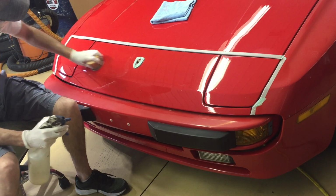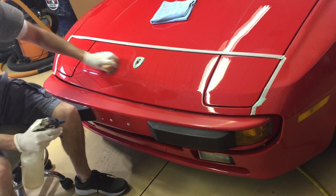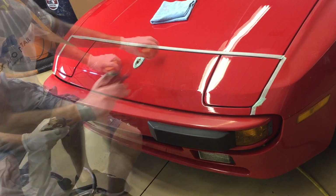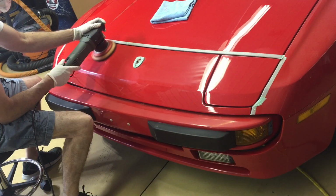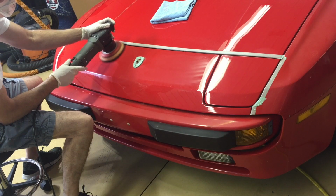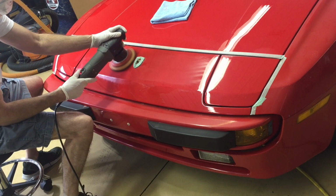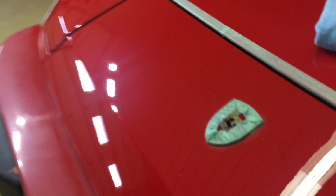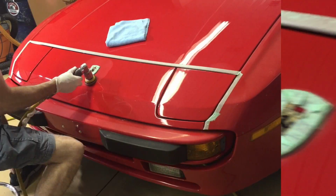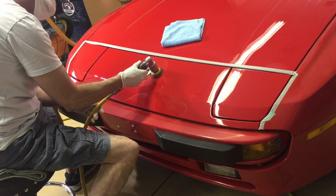So what I showed you there were scratches and some swirls that were underneath a layer of the oxidation. And we're going to try and remove a little bit of them. I'm going to grab 3000 grit and sand a little bit in between the edges and the high points on the panel. I'm going to stay away from the edges. We'll stay right in the middle, and we'll put that down, grab the polisher, polish out the 3000 grit sand marks, and it will be much improved. It won't be perfect, but we wanted to get a majority of those scratches out of there before we move on, and we will be polishing, so that's going to help remove some more. As you can see, all we have left now are a couple stone chips, some gouges here and there, so now we can go and work around the emblem. Get that all cut, and we can move on.